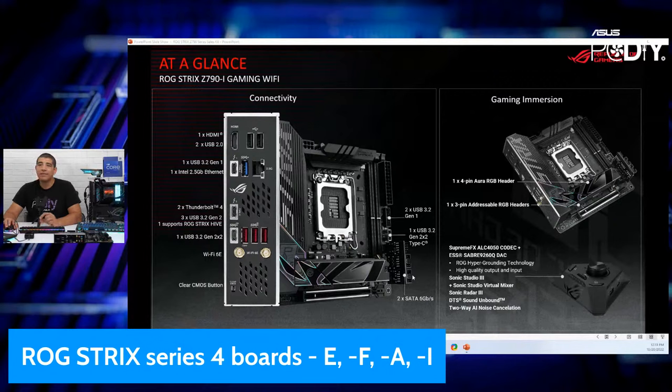You also have the alteration mode switch, which I talked about already before, which can be quite advantageous if you're using a riser cable. So we see a lot of people use riser cables in these small form factor based builds. That is also going to be present on there, right? And then that internal USB-C connector is also going to be a 20 gigabits USB-C connector because it's USB 3.2 Gen 2 by 2, right? So you have a high speed based connector.